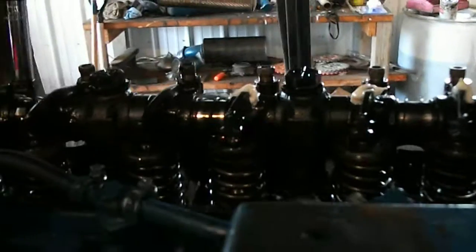This is kind of what it looks like underneath there. I actually put engine assembly lube on the valves I'm going to adjust — the first four — because that helps you know when you rotate over which are the valves I already adjusted and I just got to do the last four of them. It makes it easier if you don't have a book to go along with, for example.